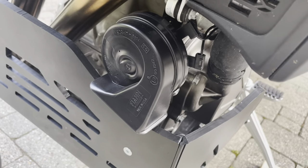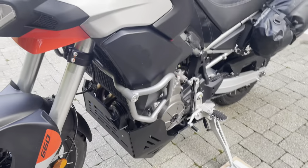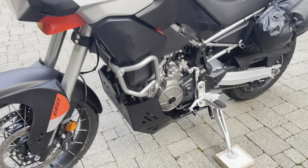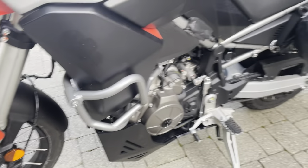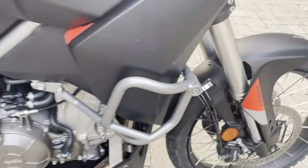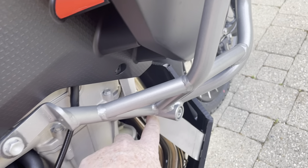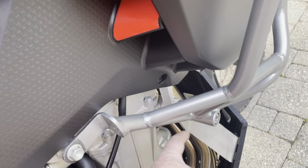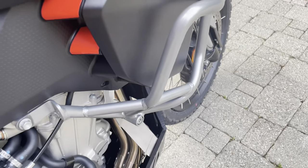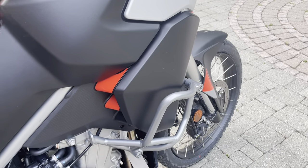There's that horn you can get from Amazon — it's like $11, super loud, totally worth it. The AXP skid plate — no problems putting the AXP on except one spot. All the hardware came with it, but adapting from here to the crash bars, this had to be cut back about 4 millimeters. So a little Dremel time on that.